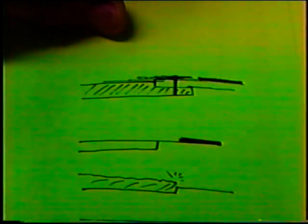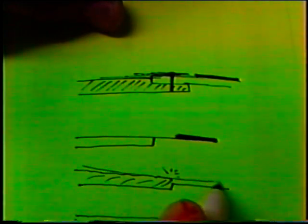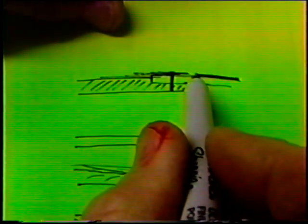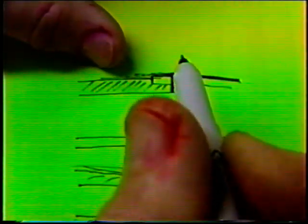I don't want to have a big ridge. That's what I'm trying to avoid, is that ridge. Then when it's of course finished, I want to fill this whole thing with clear so that I can buff it out. The ultimate thing would be that I can rub my hand right over and never feel the transition between the canopy and the paint, the same way you can't feel the transition between the lettering or any of that stuff.